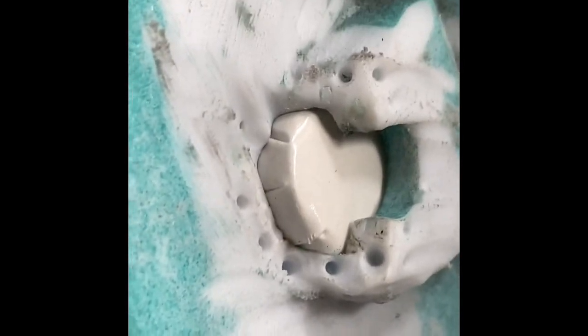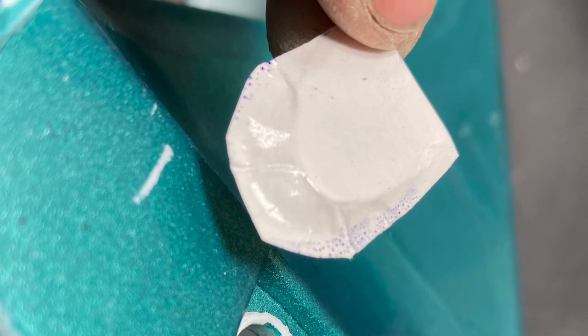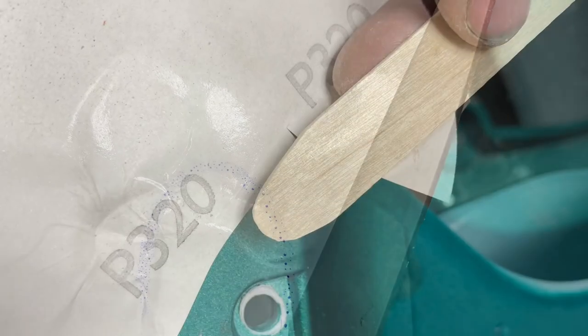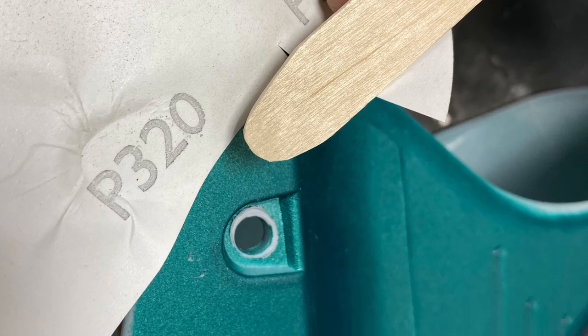But I think it might be slightly abrasive, so it's not for car detailing as much as paint prep. But I washed them really good with that. Because they're small, I took them up in my shower and used hot water and dish soap and Ting and scuff pads and really washed all that grease and rubber and tar off, because I did not want to have any conflicts with adhesion once I began to apply the primer.